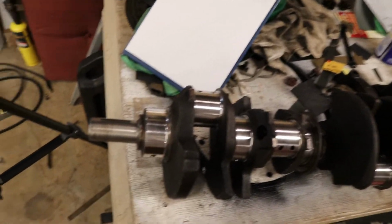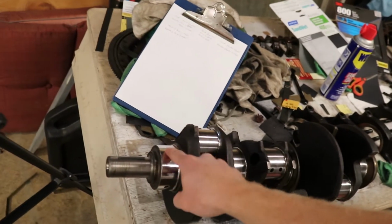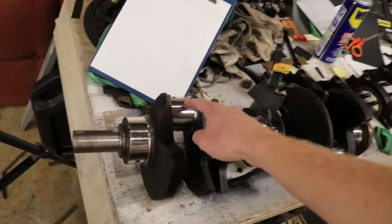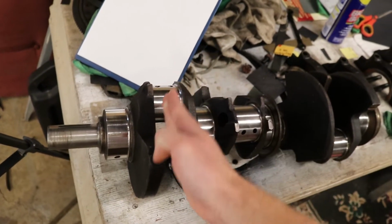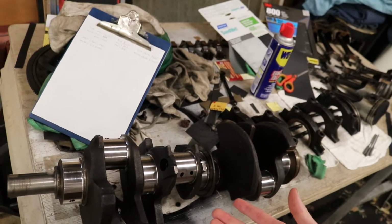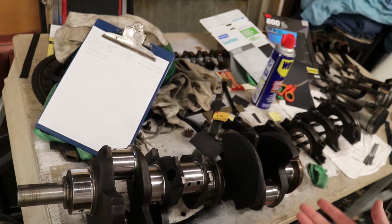But nevertheless, this was 400, 800, 1500, 2000, buffed, and I'll probably do another polish. This is 4 and 8, I'll probably do 8 on that again, and then I'm just going to do 8 on all these. But 800 grit, 1500 grit, and 2000 grit are probably going to take off in the 100,000ths range. I mean, they're not going to take anything off.